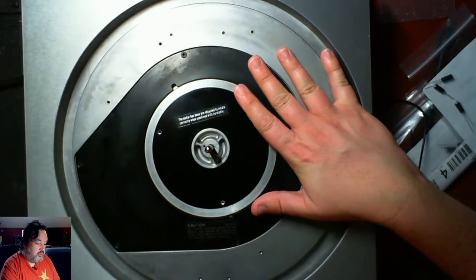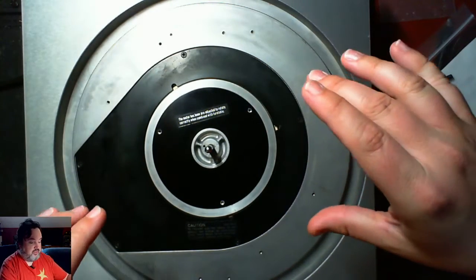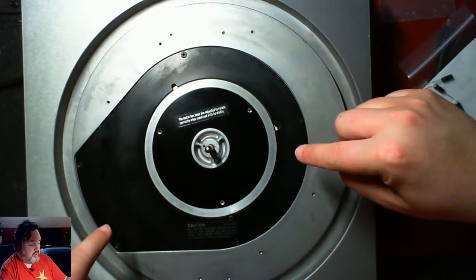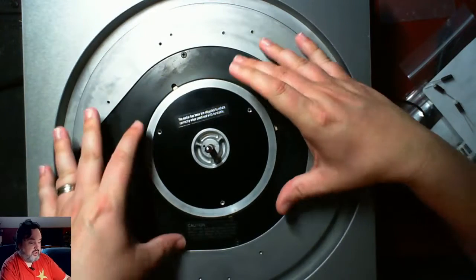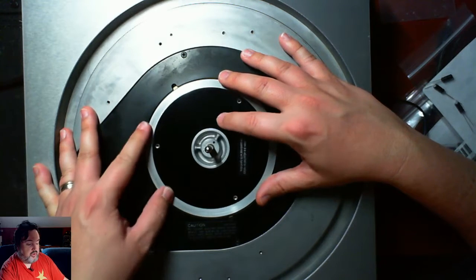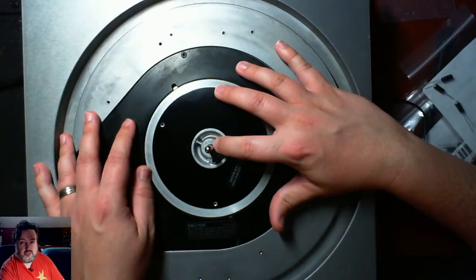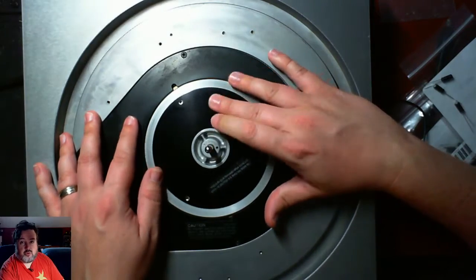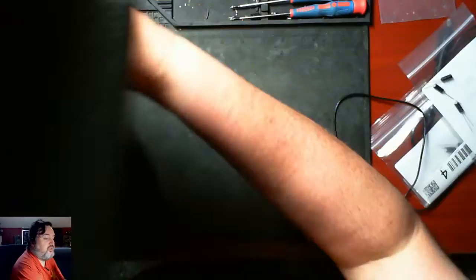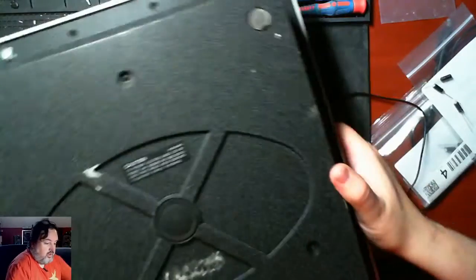You would think that you'd get into it from the top. On the Technics SP10 Mk2, this top part just holds the brake. Here is where you put oil - these things only need a couple drops of oil about every year or so. I've already done that, so that's been addressed.